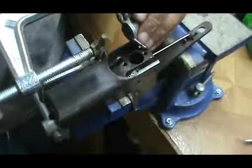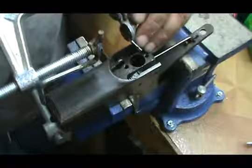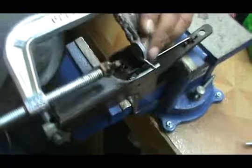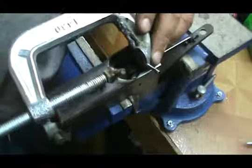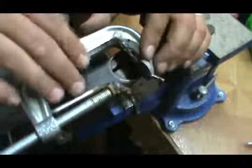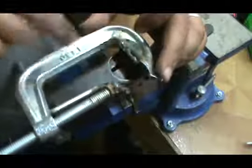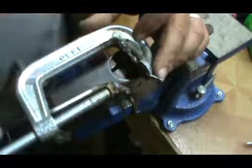We tried to manhandle these springs several ways. I looked at a lot of different plans on the internet — they were talking about milling machines, aluminum, set-screw plates, a bunch of complicated stuff. This is sort of the redneck version. I've got about four dollars in the clamp and not a whole lot in the rods. The only redo I'm going to revisit is trying the three-sixteenths here — I think that'll be a lot more rigid and it won't bend. I've installed both springs twice now, it hasn't broken on me, just bent.